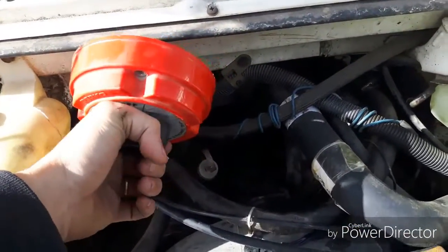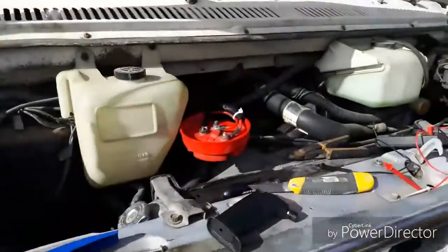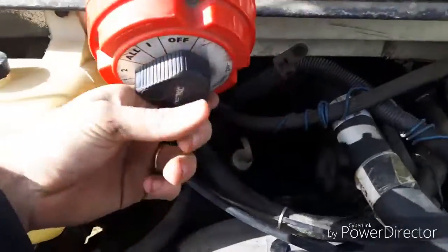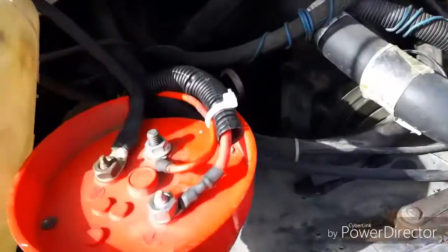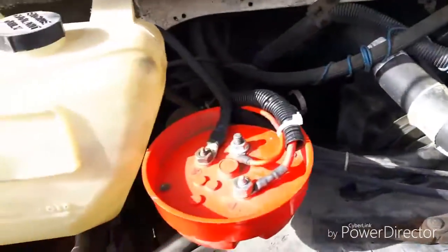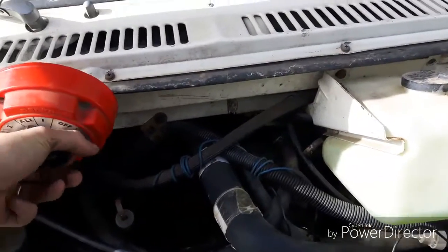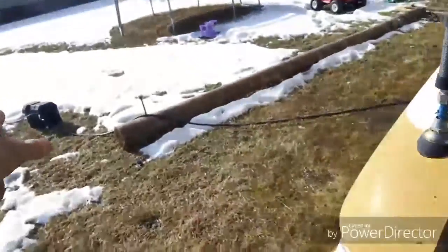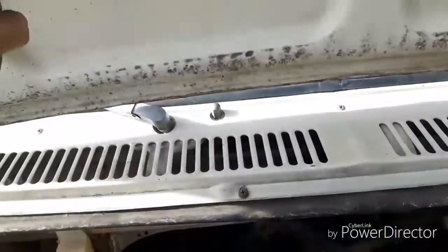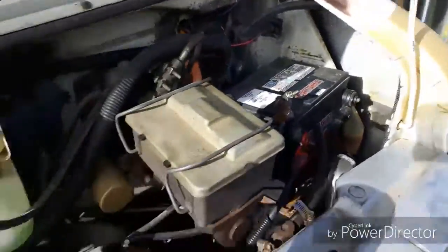If it's off, nothing. If I slip it to one, it sends a charge from the alternator to the onboard battery back there. If I slip it to two, it goes all the way over here, then sends current from the alternator out to this wire which, for some reason, comes to here. I'm going to take that out and throw in a secondary battery that I can use as a boost pack — essentially throw another 12-volt starting battery in here, or maybe underneath one of the seats. But that's not what this is about. Although, this is kind of cool: if I flip this to one I have the camper plugged into shore power, it sends the power from the onboard charger to that deep cycle battery, and then sends the current up this wire through here to the alternator and to that battery, so it does always keep that battery charged.